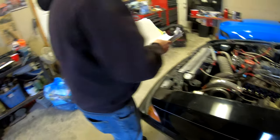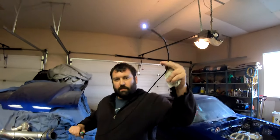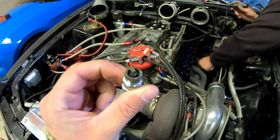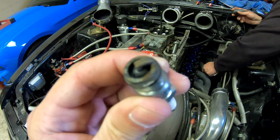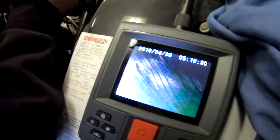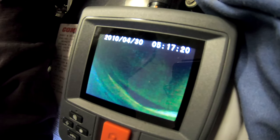Anyway, Clayton found a little bit of rust on this plug. He might have wiped it off — it was just a tiny smidge right at the top where the rings meet the cylinder wall. With the bore scope you can really see the crosshatch. Probably no issue there — we'll pull the rest and see what's up.